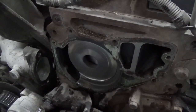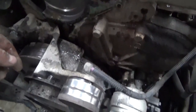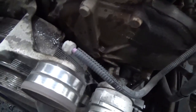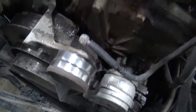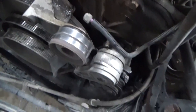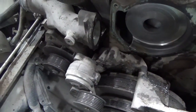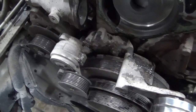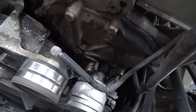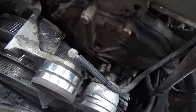We've got the bolts all out and we've pulled out that water pump assembly. One other thing I wanted to mention — always check your idlers here. If you hear that one, it doesn't sound the best. So while we're in here with all this torn apart, we're going to replace all those idlers and the tensioners as well. This engine has probably 750,000 miles on it right in that neighborhood. You can hear it — it's going to be a problem if you don't take care of it.